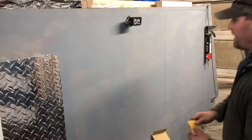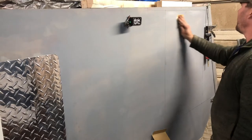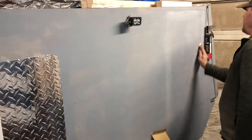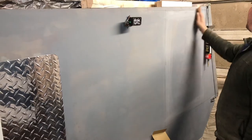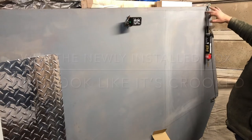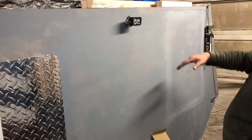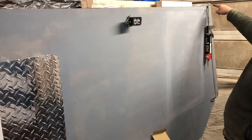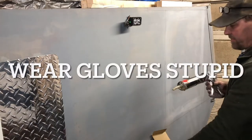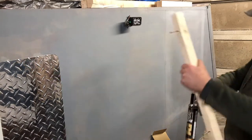Roughly 10 inches out — wheel well depth is 12 — so we're going right at it. I pre-cut some of the stuff; this was primed but I don't know if it makes a difference with PL. The way I built the trailer, the two-by-twos that are on here go from an inch and a half all the way down to nothing at the front. So when the trailer's parked and we're camping and level, it'll take the water from the back near the galley to the front. Use the PL — this stuff's incredible, hate working with it but it does a heck of a job — along with regular wood screws.